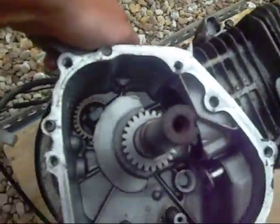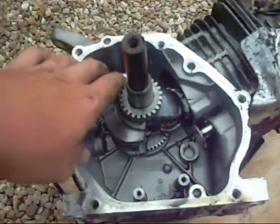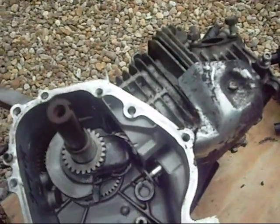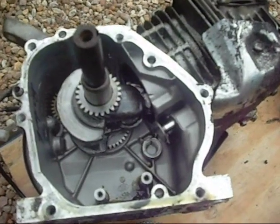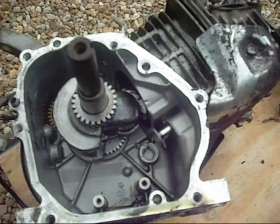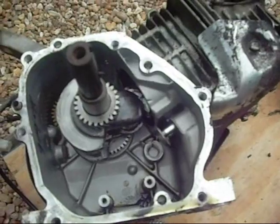The governor stops the engine revving too high or too low, because these engines are not built to rev to the red line. They're built to around 3000 RPM and that's about it. That's why it's huge displacement — 200cc — but they don't make any more than 5.5 horsepower, because they don't rev.